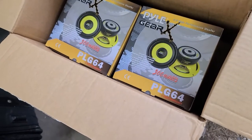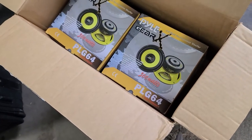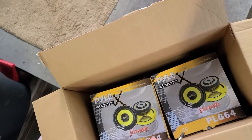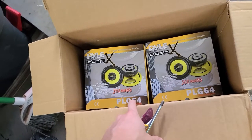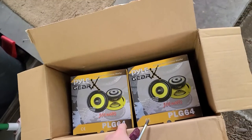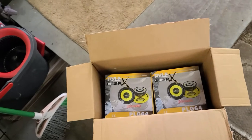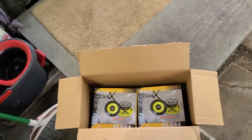So these are the new door subs I'm going to be installing. These are 6.5 inch Ply door subs and they are 300 watt. I'll link them in the description if you're interested — best bang for the buck. These are technically 4 ohm speakers. Most 6.5 inch subwoofers you can purchase are 8 ohm, and you don't want those. You want 4 ohm because the factory ones are 2 ohm. It's just that you'll have to turn the bass up a little harder to power a higher ohm sub. Get the 4 ohm or 2 ohm if you can find them. I got four of them because there's one on each door and I'm changing all four today.